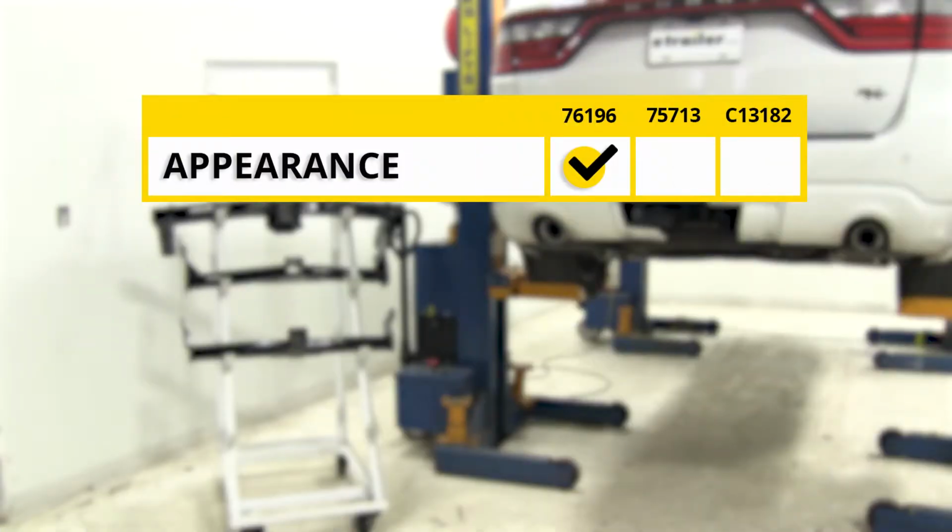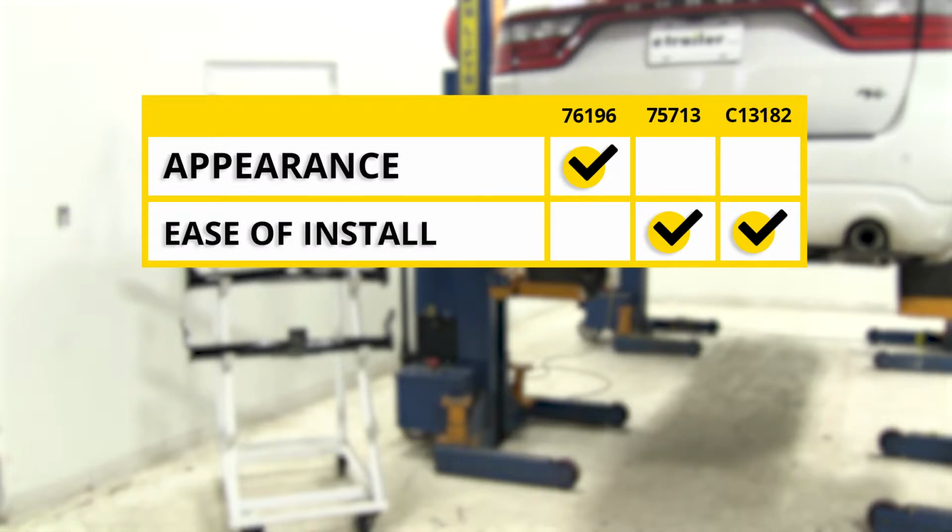So to sum everything up, if appearance is a big concern of yours, I would definitely go with the Draw-Tite with the hidden cross tube. It's not going to change the look of our Durango when we're not towing because we're actually going to be able to use the door for what it was intended for. If ease of installation is a big concern of yours, the CURT or the Draw-Tite that's going to sit below the bumper definitely is going to be easier to install because we're not going to have to do any kind of trimming or remove the fascia.